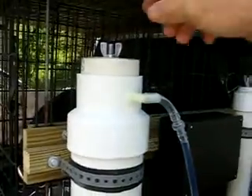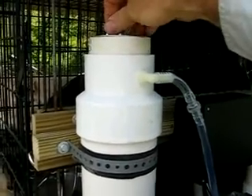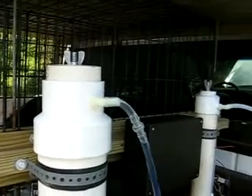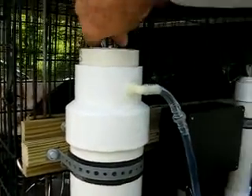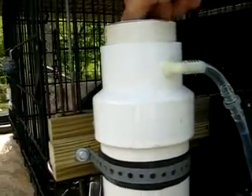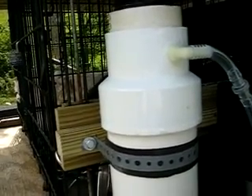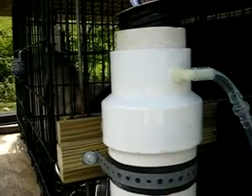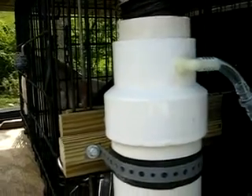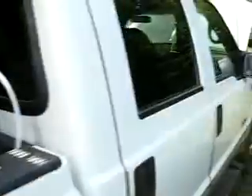When I got here I checked and this cap right here had popped loose — it was just sort of loose and sitting there. I greased it with a dielectric compound to make sure it would pop out in the case of a backfire or flashback. It squirted up like this, so I wasn't getting the HHO to the front. When I tried to push it back in it would immediately squirt right back out again, so I was getting back pressure. The only place I could think of for a restriction was my flame trap.